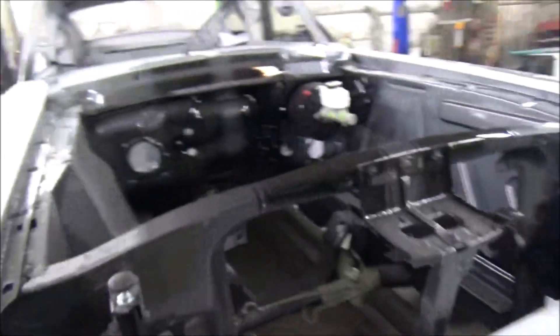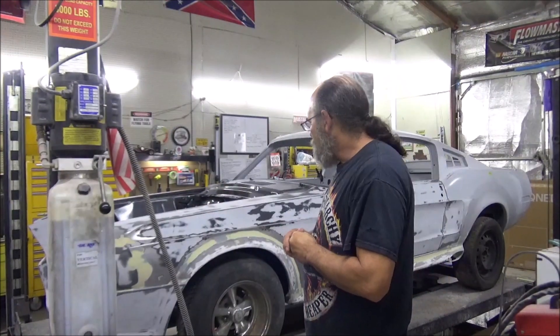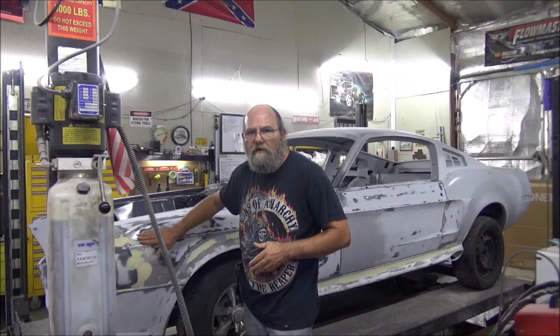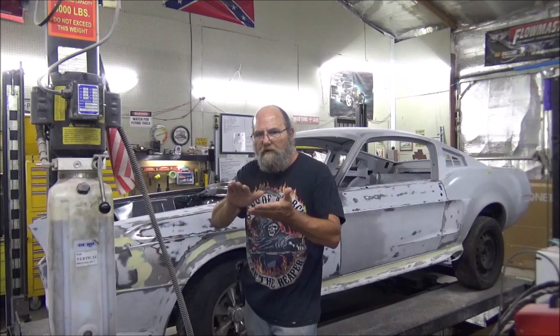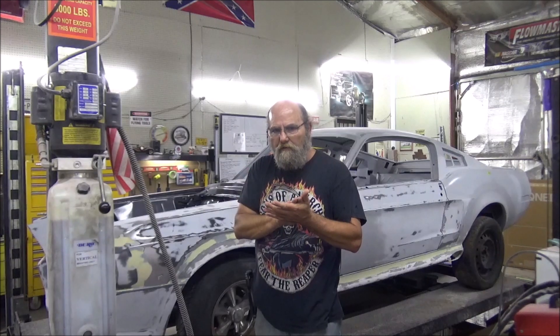Going to be a lot of taping once we've done painted all of this - we'll get it washed up and super clean before it heads to the paint booth. So that's got you caught up on the Mustang. The next thing I'm going to do is sand that door out, get that all done, then I'm going to go through slowly and carefully. I'll be comfortable with my hands and feel the places - like if I feel a little bit of not so perfect transition between the metal and the filler, or between parts, then I'll get out some of my white putty, the finishing putty, and just go over them.